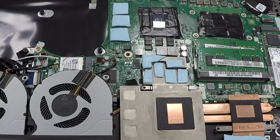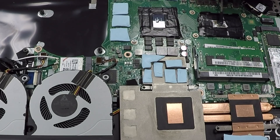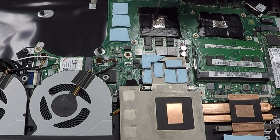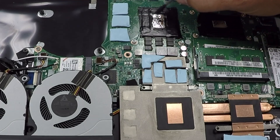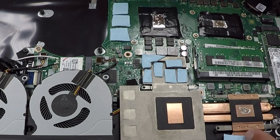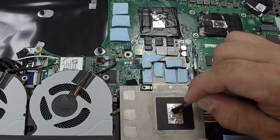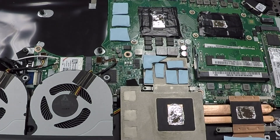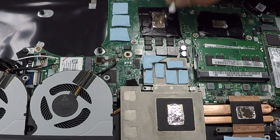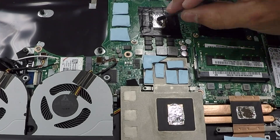Squeeze the liquid metal out onto another surface so you can get an adequate amount for the GPU and CPU. If you put too much it will squeeze out over the electrical tape when you attach the heat sink, so it's really important you put a very small amount on the GPU and CPU die. Take your q-tip and roll it around on the GPU and CPU to ensure liquid metal covers the entire surface. Also add a very thin layer to the copper plates on the heat sink. Use the other end of the q-tip to roll over any puddles — I noticed when I put it back together some moved onto the electrical tape, meaning I had too much.